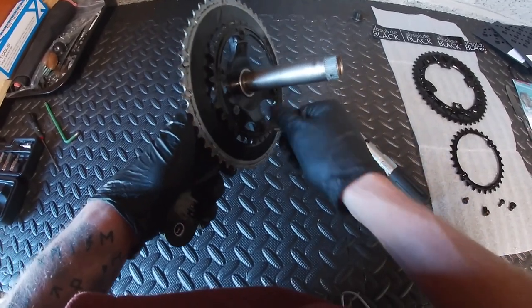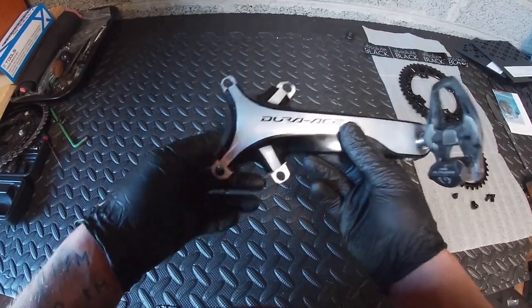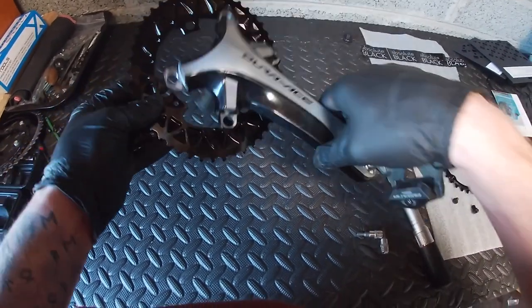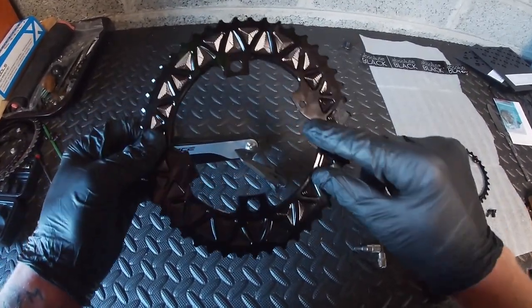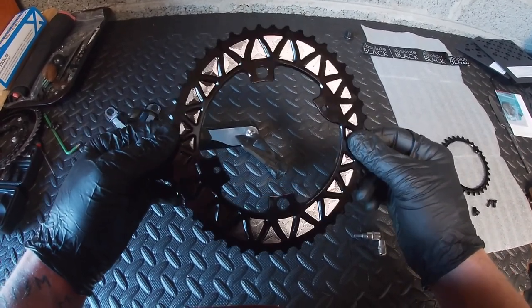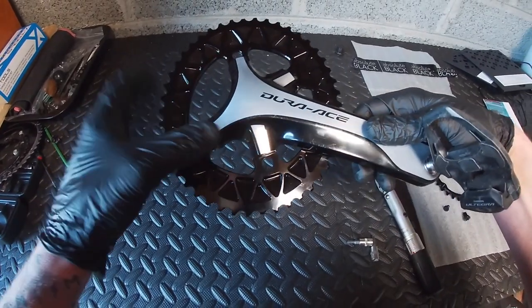Smells like burnt hair. We've just cleaned that up a little bit, make it nice and shiny as best we can. So we're going to get the 46 oval chainring and orientate it. As you can see, we've got a curved edge here — you can see it there just in the light. It's a nice curved edge; all the rest are kind of square. So the curved edge goes top right as we're looking at it.